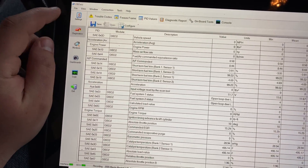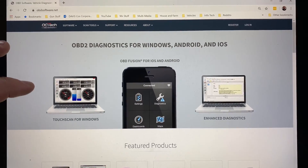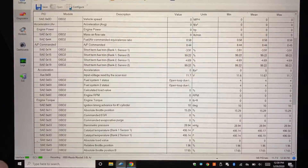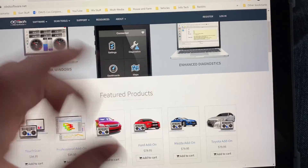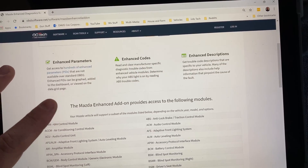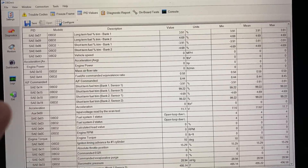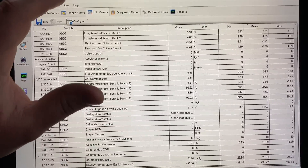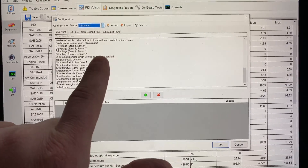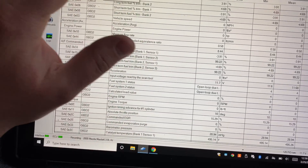One of the products I've purchased is OBDWiz — it's a pretty decent application and I've been fairly happy with it. This is not a sponsored video. It came with my OBD-Link MX dongle, and I purchased the Professional add-on and the Mazda add-on. As I went through it, I noticed I don't see all the PIDs the Mazda add-on is supposed to come with. If you go into Configure for PID Values, there is not a lot compared to what should be there for the Mazda — these are all very basic standard PIDs. What you need to do to get the enhanced PIDs is go to Help in OBDWiz, then License.